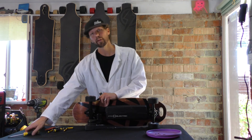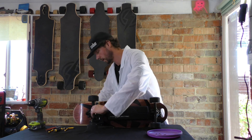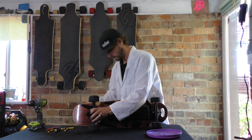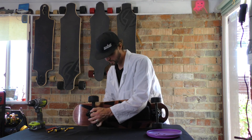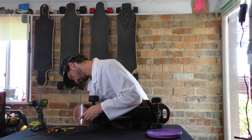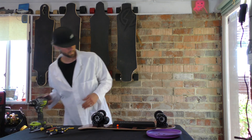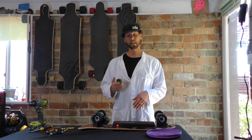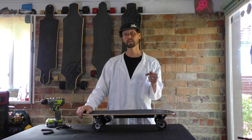Use your T-tool and a Phillips screwdriver to get the truck nice and snug. A lot of people don't know this, but having tight hardware is one of the keys to having a precise truck. You can have the best high-precision truck money can buy, but if you have loose truck hardware, a lot of the precision is lost between the base plate and the deck itself. So get those guys nice and tight. And just to do a final check: turn your power on, make sure that's good to go, then turn your remote on. Watch your battery lights and make sure the board runs. That's pretty much it. Thanks for watching — if you've got any questions, leave them in the comments below and make sure you hit the subscribe button to stay updated with all the new Tech Talks with R&D Lee.